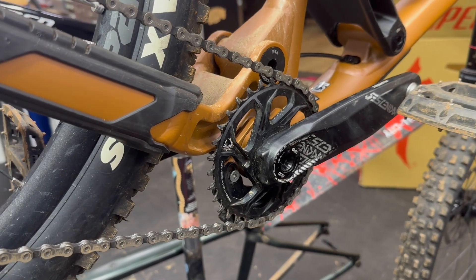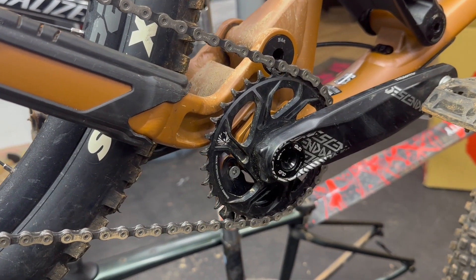Whether this is 8-speed or 12-speed, it works, assuming that the chain, the cassette parts, and the derailleur are all of the same speed — which they probably should be if you're starting from this point. And then as far as the chain ring goes, it's a standard chain ring, so we're really working with all the parts that came on the bike. Whether you decide to use the parts already on there or find some used parts at the local bike shop, you can do that as well.